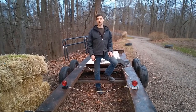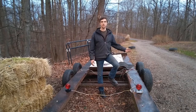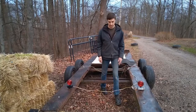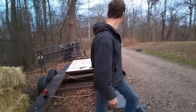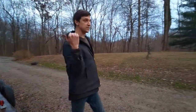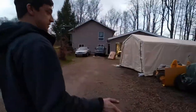I checked the brakes — none of the magnets in the electric brakes were good. We've got four new magnets for the brakes. I've got a new set of shoes and hardware for another side of the brakes. It needs completely rewired. It needs a breakaway box in the front. It basically needs completely revamped on the electrical side — most of the brakes, some of the suspension. And then some work needs to be done in a few places. The cool thing is, number one, it was cheap, and it actually pulls fantastic. The trailer's probably way, way back burner — that's a bigger project.